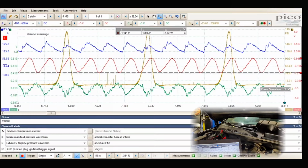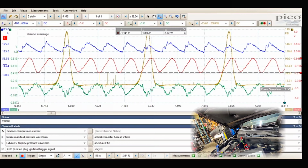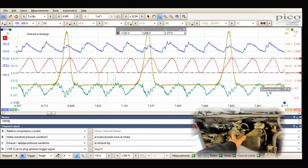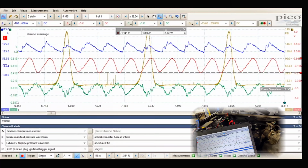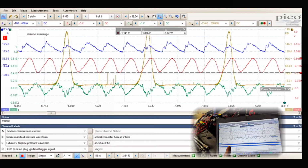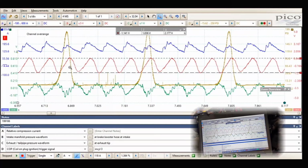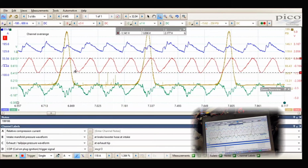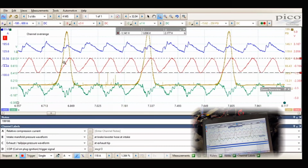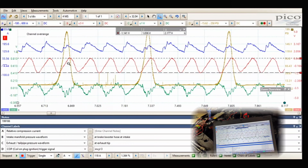So guys, what I wanted to show you isn't gonna work because I tried doing it, and then another cylinder had dropped out. I think it was cylinder 2. Showed like no compression when I blocked the intake off. And then I tried just doing the same test again that I showed you guys, and this is what we got. So we got our intake pull right here is not as much. Like we don't have that pressure rise anymore in the intake. So it's just the valve is leaking. It's kind of the only thing that it could be.